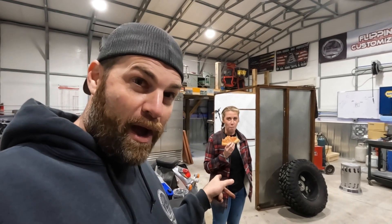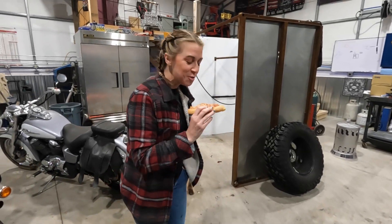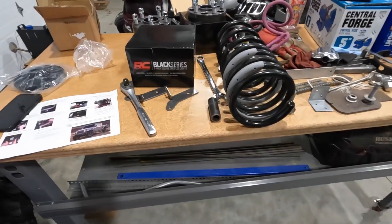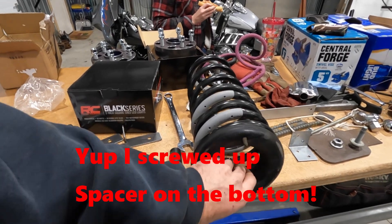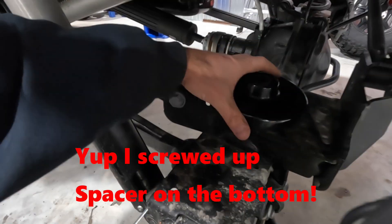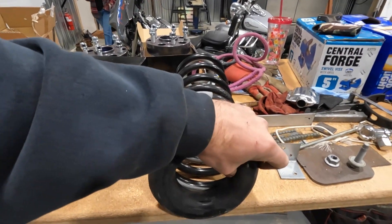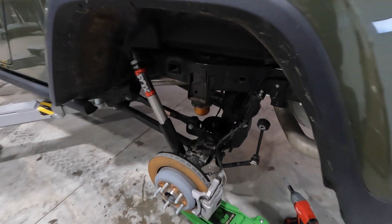The wife, Jen, has made it here to work on her Jeep - she's going to dig in and get her hands dirty. Here's the rear spring that's now out. This is the rubber isolator on the top and I may have misspoken earlier - it does not replace this isolator. The three quarter inch spacer actually goes on the bottom. So it just sits on the lower perch and the spring will sit on top of that. You keep and reuse the thin isolator that goes on top. Good lesson learned - we probably could have done this without fully removing the spring now that I know it goes on the bottom.